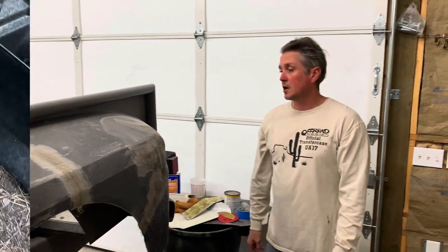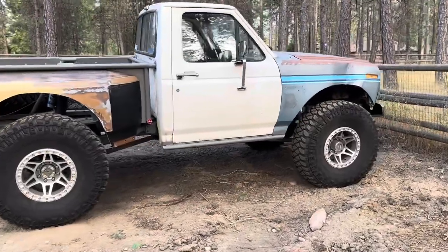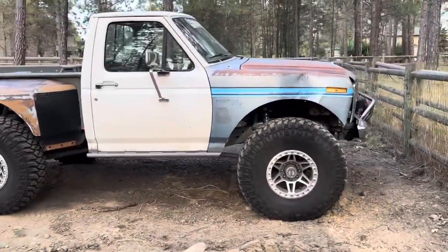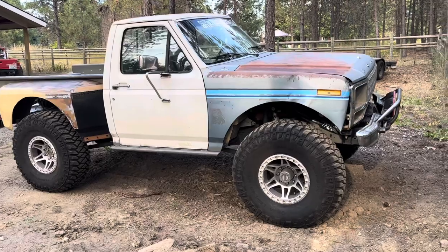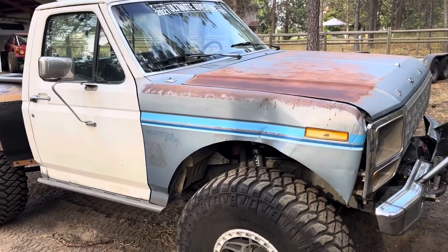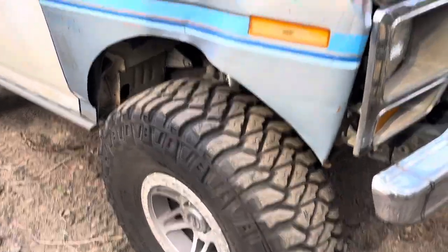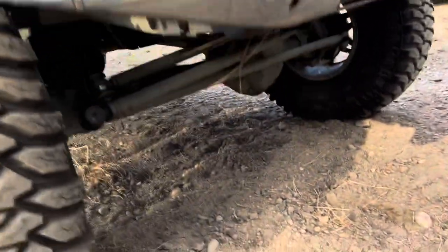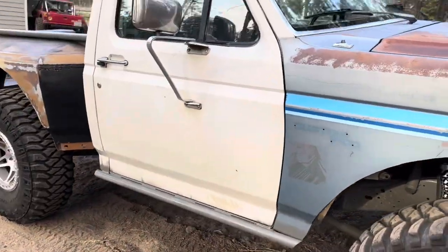This is a follow-up on Mom's Spaghetti after the UA Carnage Edition — this is where I sort of have to put the pieces together. I didn't mention what the truck even is in that video because I wasn't planning on using it for YouTube. Mom's Spaghetti is a 1990 Ford F-350 pickup with a 1980 front clip on it. It's on 40s, on one-ton axles — it came with a Dana 60 in the front and a 14-bolt in the rear, and it's got a Chevy rear axle in it.